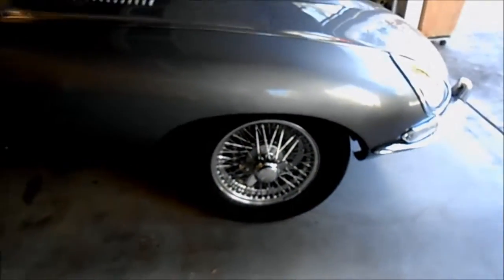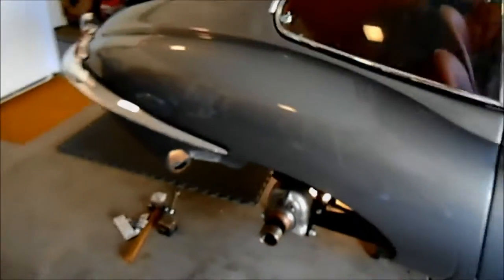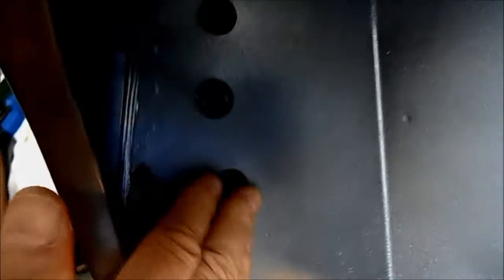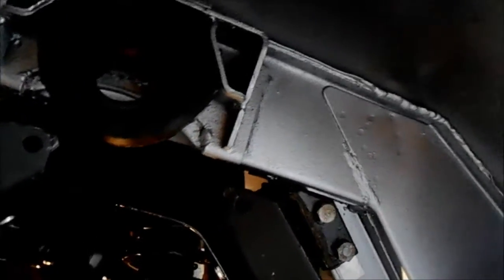I think it's gonna turn out real nice. While up in this wheel well I noticed the previous owner had drilled holes in the bodywork — four on one side, three on the other. I was able to fit some plastic body plugs in there. There were some sheet metal screw holes I put caulking on, and I sealed these over with butyl-based caulking. Where rivets and screws punctured the bodywork for the rear interior, I also put caulking over those to prevent liquids from seeping through into the interior carpet and trim work.